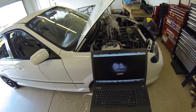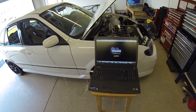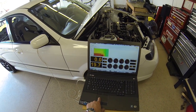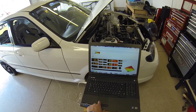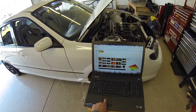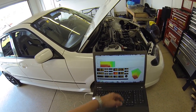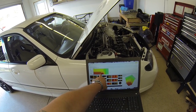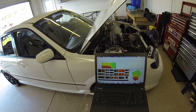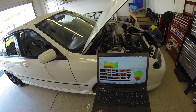This program was made by Haltech at my request. I gave them a detailed document basically saying I need you to make me a program. Generic duty cycle is what's used — the two axes are temperature and manifold pressure. You can see the blue dot sitting at zero right now; that's where we're currently sitting. I do this so I can load maps without it interfering with anything.